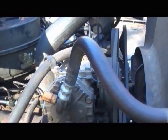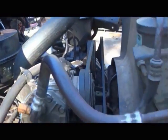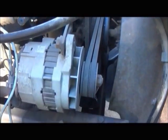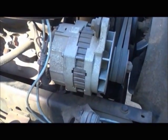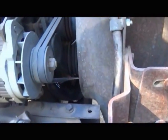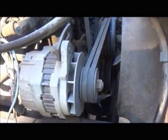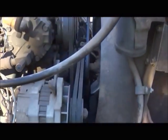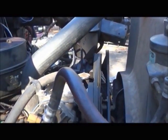I put an injector pump on it. I have changed the entire fuel filter housing, of course a new fuel filter, pulled the tank, checked the suction tube in the tank, replaced the transfer fuel pump twice. The first time I replaced it, this thing seemed like it ran good for two weeks, then went to crap. Put this new one on and it's not run right at all, and I'm finally getting good signs of air in the lines.